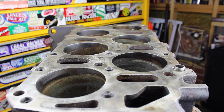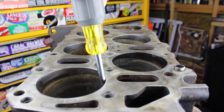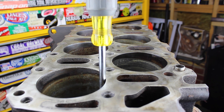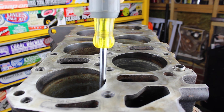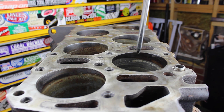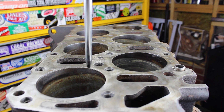Let's take a look at this 2.8-liter VR6 block — a 15-degree V. A traditional V engine would be about 90 degrees or 60 degrees, and the newer direct injection versions narrow to 10.6 degrees. I'm going to lay a screwdriver in the cylinder bore — you can actually see that angle. The way the screwdriver comes out of the bore isn't perfectly perpendicular. This is a good demonstration of how different the angle is on a VR6 block versus a traditional engine block. You can also see the difference in combustion chamber shape — wider on the outside, narrower on the inside.